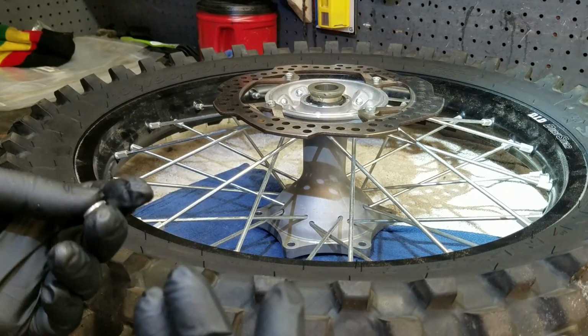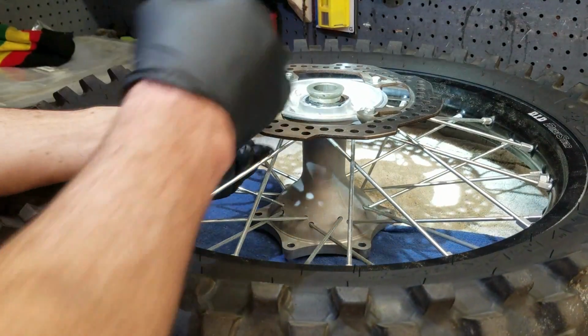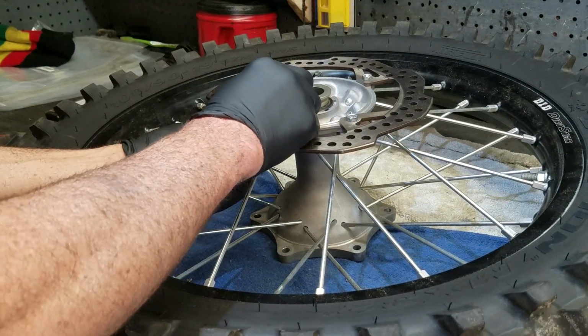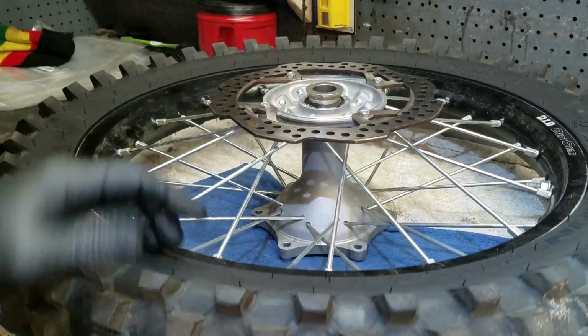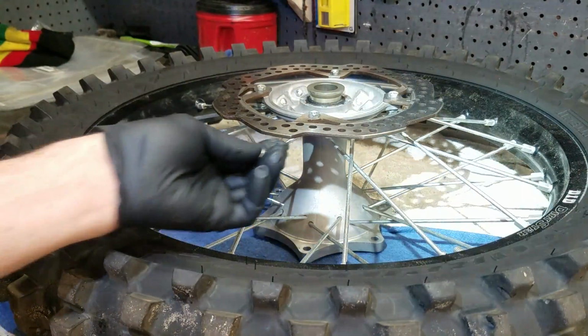I would say anywhere from first to fourth gear is fine. Just stay out of fifth gear and vary your speed. So don't get it up to fourth gear and stay there for a prolonged period of time. Bring it back down in speed, bring it back up in speed. And the reason I say this is because you're also breaking in the transmission.